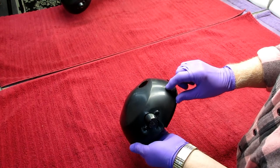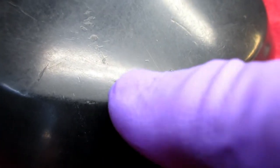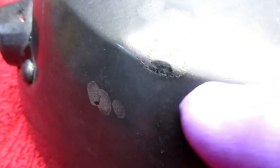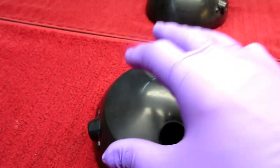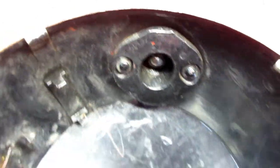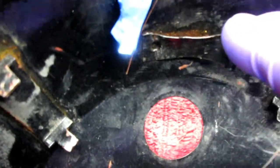You can see that spot — that's been rusted through, there's rust underneath, so that's a problem. This is another little problem. I can safely say somebody's already repainted this once, because they've trapped the moisture and rust in there. There's a spot down here too, so the cosmetic outer cover is going to require a lot of sanding. But the first thing I want to do, before even that, is address this inner rust — it would come through and ruin the project a couple years down the road. There's also rust down under there — that little wire gate holds the wire — we're going to try to get as much of that out as we can.